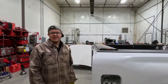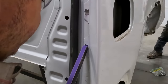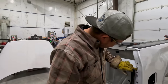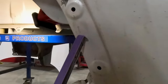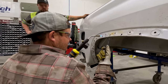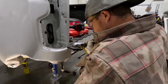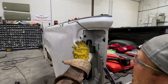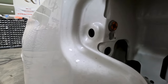I'm not going to do the top — I just want to rip the side off, but it's going to be just as easy to hurry and belt grind these as it is to cut the outside skin. Got them all cut. These are spot welded and they're glued. To get the glue to separate, use a little torque, heat it up, and it'll pop when it's ready. We've got a couple more spot welds up under here and the lower portion of the bedside — I'm going to cut it here. Basically I'm going to leave just the top rail. When you're grinding these there's a sweet spot — you don't want to go too far, but when you do it long enough you can actually see a ring form, and you know it's cut through.